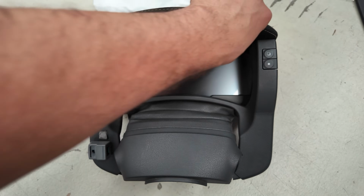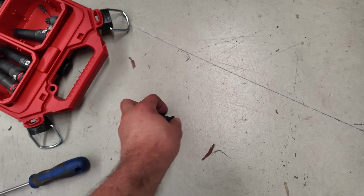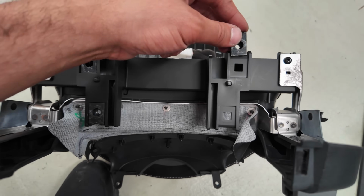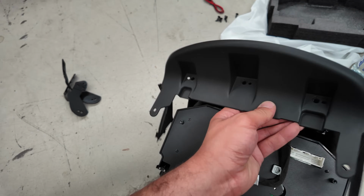Now, once you've put the digital cluster screen in its position, you want to then go ahead and remove brackets for the screw placement from the old OEM cluster from here. Slide them off with a flathead, and just like that, sliding them on, making sure the small hole is facing down towards the cluster. Put on the last piece, which is just here.